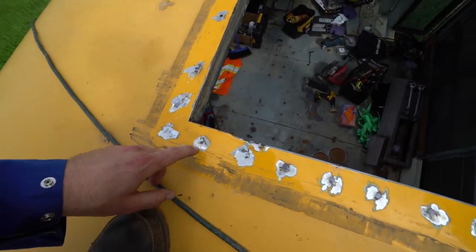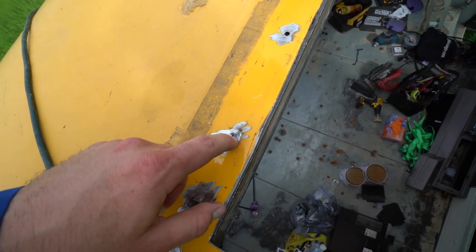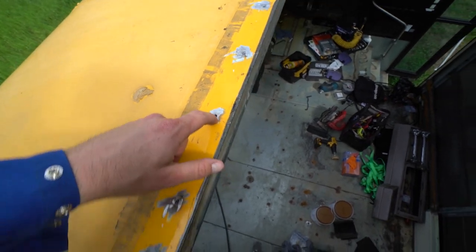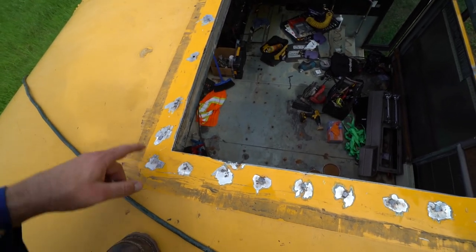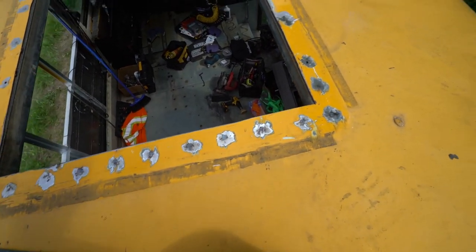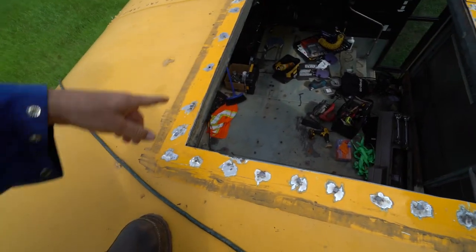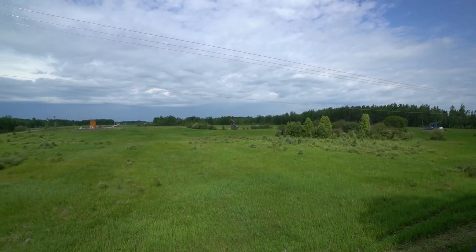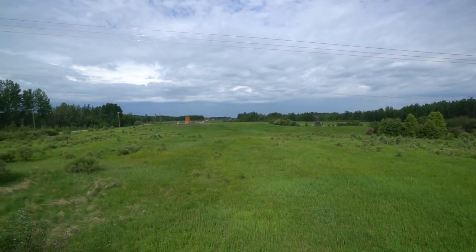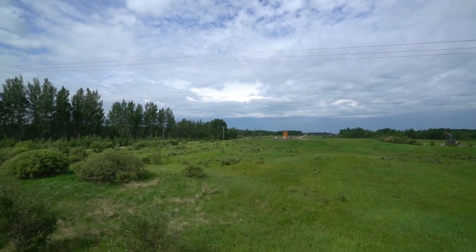It looks like I may have grinded these a little bit too close. That one just needs to be touched up a bit, but this one kind of popped out. I forgot that we're gonna be putting some butyl tape on top of this, and really this is just kind of overkill. But it's gonna completely seal and waterproof these holes. Also, today there is another tornado warning - if the sky turns green, run like the wind.